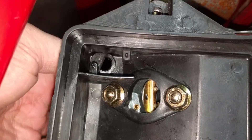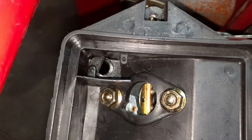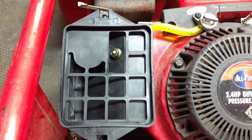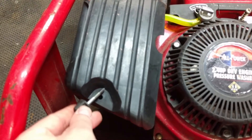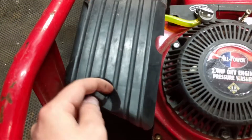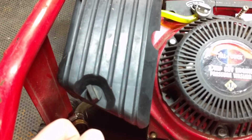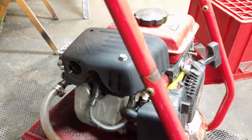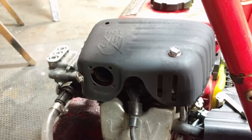Press the valve breather into the back of that hole. Once you get those tight, go ahead and put your little piece on there, then get the air filter on. Once you get your air filter in, put your outer casing on and thread in the little thumb screws. We got our muffler shroud back on with just a couple of 10 millimeter bolts.